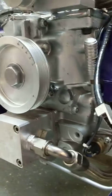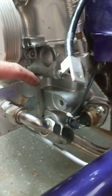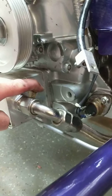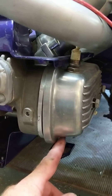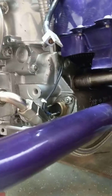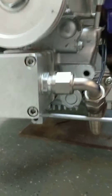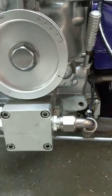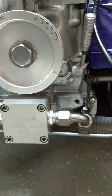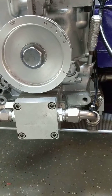There's an extra port on this side that I have plugged off. You can run that to, let's say, the bottom of the valve covers — maybe right here — or if you have another type of sump, maybe I could put a sump plate on the very bottom. But what that causes is the oil is going to come from the path of least resistance.